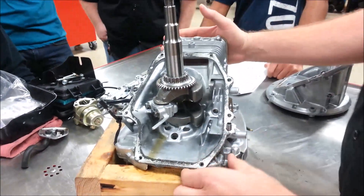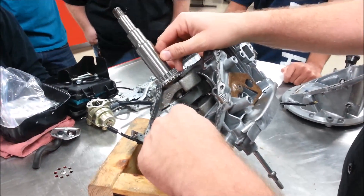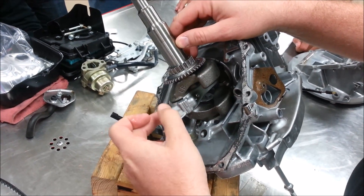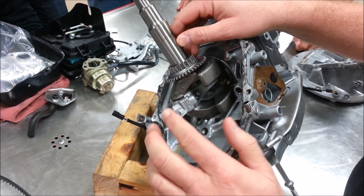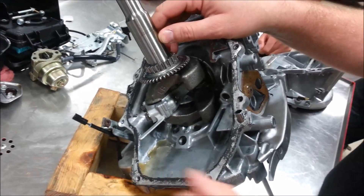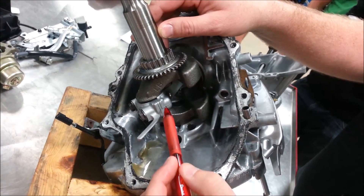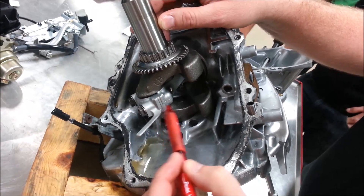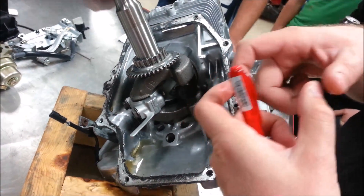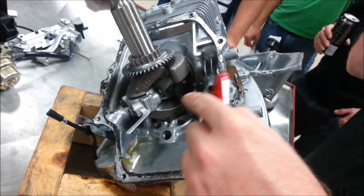Something we're going to learn about connecting rods is that these rods are sized and machined to only fit one way — every single connecting rod in the world, whether you're working on a car, truck, or anything. They are directional. In motorcycle applications, you're going to find a letter A stamped across both halves so that when you put the rod together it makes the full letter or number — sometimes it's a one, sometimes it's an A, and so on.